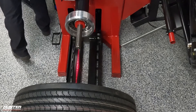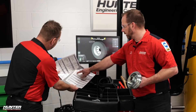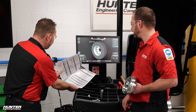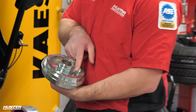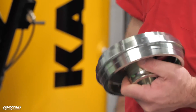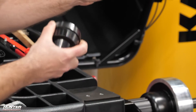That chart's going to come in really handy. If we look up a Ford dual rear wheel — it's a 10-lug — it's going to be a 450 or 550. We've got our bolt pattern here: 10 by 225. So that's going to help us set up our flange plate, which has already been set up, and it also tells us what collet to use. It's going to say 16-19, and right here I have the number 19 collet. Right on the collet, it tells us what size and what manufacturer it goes with — this one's going to be a 669. These collets are going to work with a lot of different bore sizes and different rims and tires, but this is a lot more specific for this size.